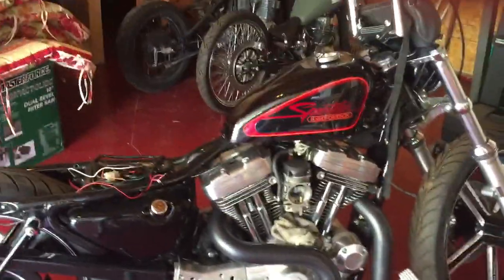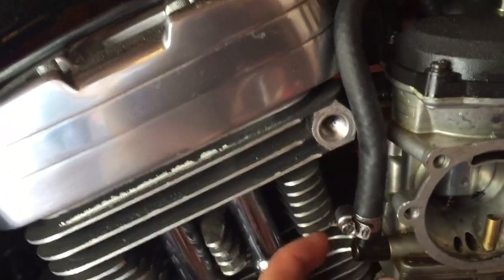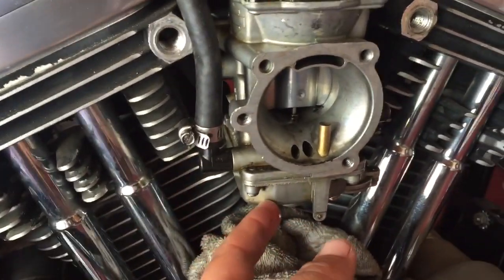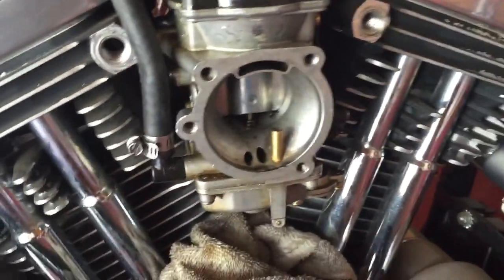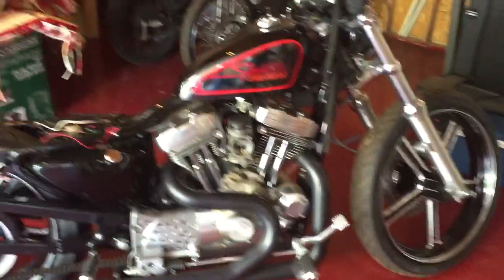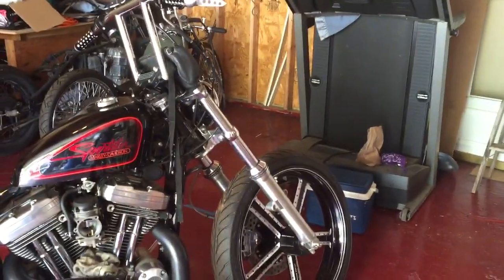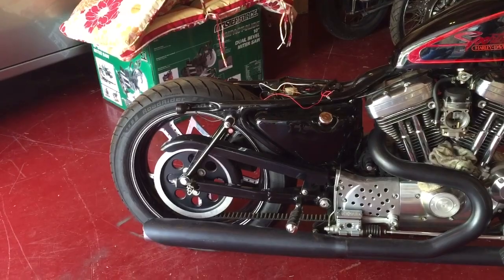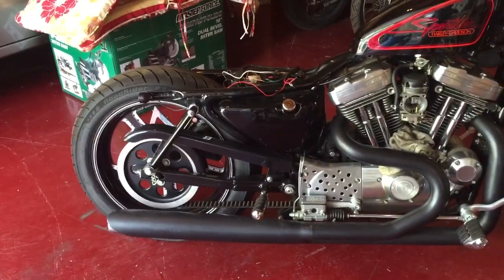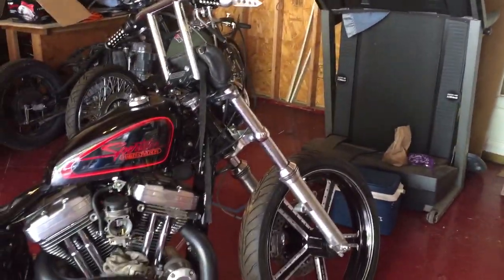I'm rebuilding the carburetor. Right here this is plastic — I gotta put a brass fitting in here, then the float stick, so I gotta clean that. I have an Arlen Ness big sucker air cleaner. This is a '93, but I had to make a lowering kit for the front — I lowered it probably like two and a half to three inches. The back is an 11 inch strut, or ten and three-quarters, maybe ten inch. I need to go down probably about another inch and a half in the front, and can't really go down too much in the back otherwise the tire will hit.